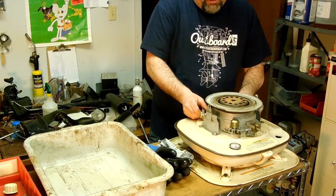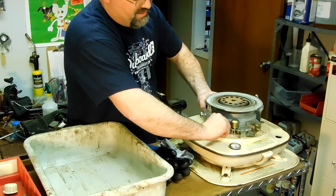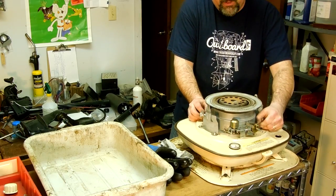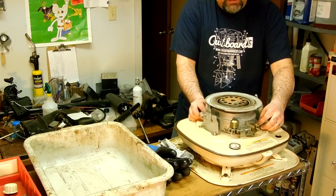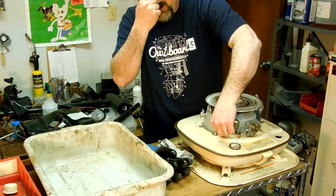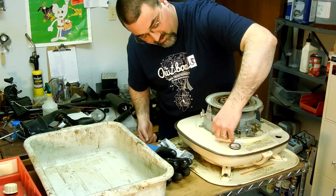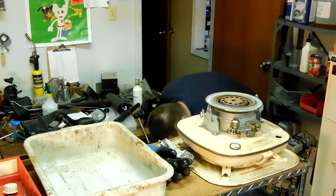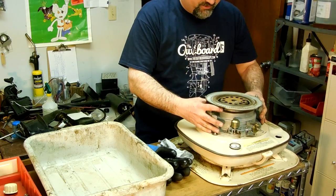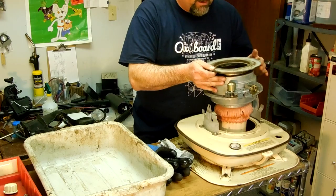Most problems with kerosene heaters are from the kerosene, which leads to the wick being the part you need to replace. One thing I've learned the hard way: when you replace the wick, don't pour kerosene down into it to prime it — it doesn't work. It traps air inside the wick and ruins it. The most critical thing is the first time you fill it up, wait 60 minutes or longer before you light it the first time. Do that right, and you won't have other problems.